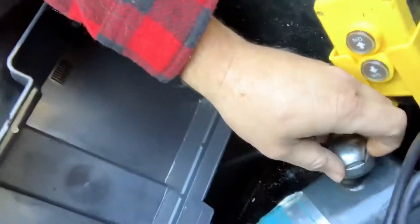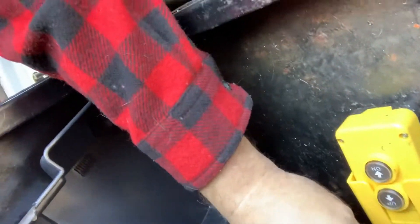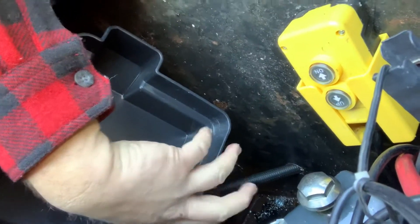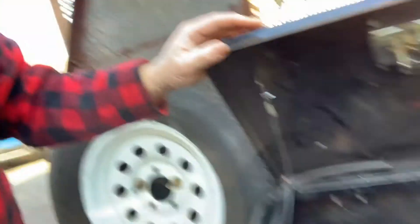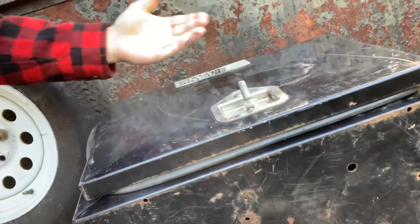My hydraulic power unit had a cap that cracked, so I took a lug nut cover off a dually truck I've been working on — it had mismatched covers — and it just fits over there like that. I bored the inside of it out a little, so it gives it a touch of chrome down there. And now when I'm done, you can shut this lid and all that stuff is protected. It's gasket sealed, it shouldn't get wet, and if it does there's a drain hole. Keeps it all neat and tidy.